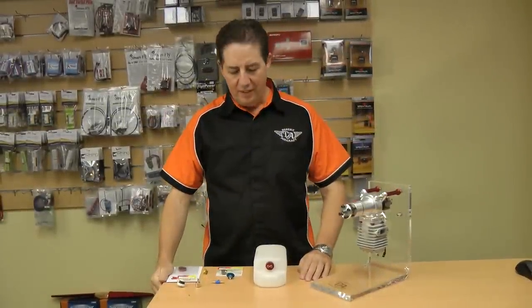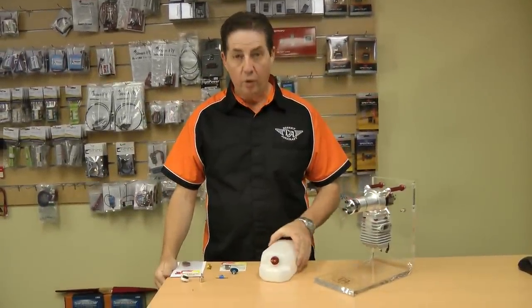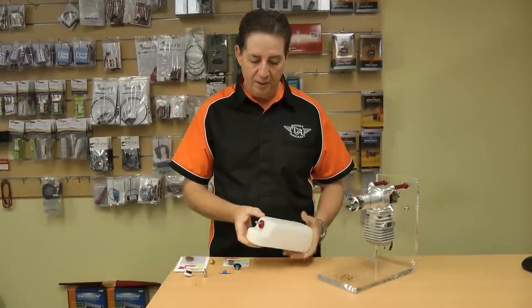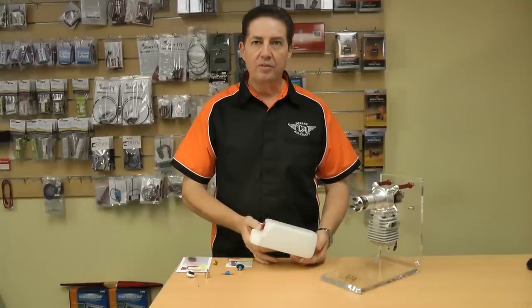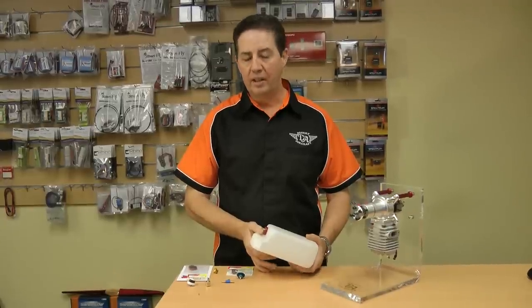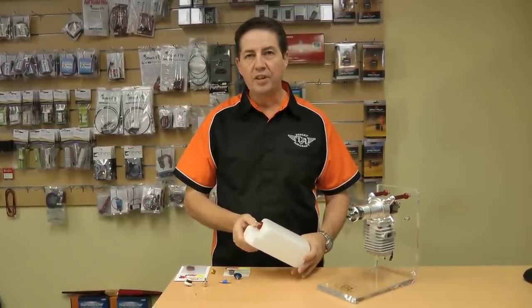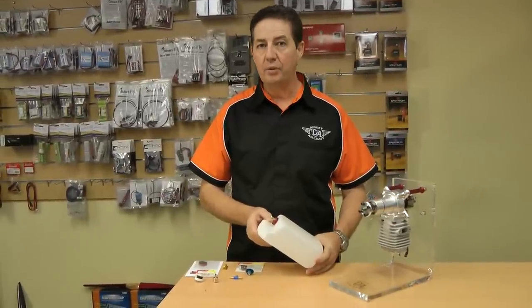Welcome to Dubro Australia. Today we're going to go over fuel tanks. We get quite a few calls regarding the best way to set your fuel tank up for easy filling, and it's an area where we see a few bad results from clunk lines falling off and just generally poorly assembled fuel tanks and fuel systems. We see quite a few come in with engines misfiring, not running right, and a lot of times it leads back to just a badly set up fuel system.